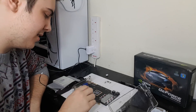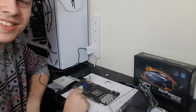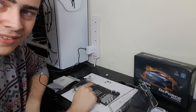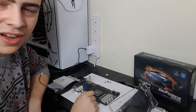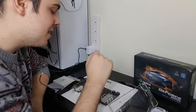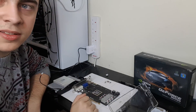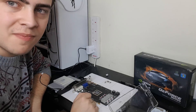I looked up the numbers on the die of the graphics card and it turns out this is indeed not a GTX 960. It is a GTX 560 — that is what's under here — but it has been flashed with the firmware of a GTX 960, so it actually thinks it's a 960, not a 560. That is a big difference — the 560 to 960 is three generations. So I'm paying £30 for a GTX 560 that thinks it's a 960, which makes it completely worthless because it can't actually do anything more than a 560 can. Is this worth your money? No. Don't buy.